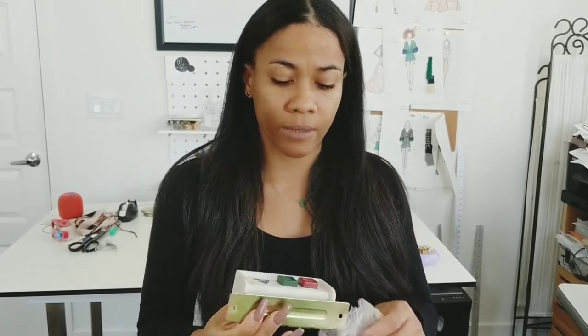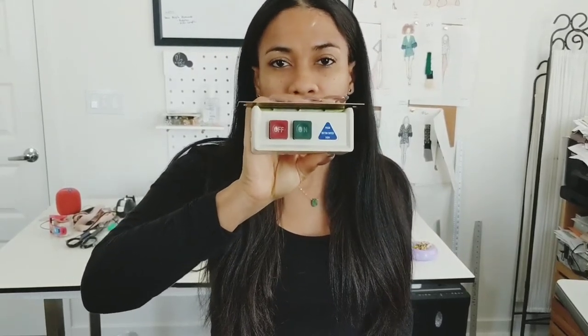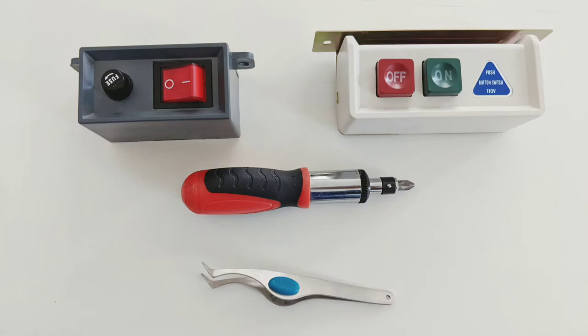Welcome to this tutorial — this is actually a trial because I'm not sure what I'm doing. Hopefully I don't get electrocuted, but the power switch on my machine went out earlier this year. My technician came out and fixed it, but it's not working again. It's the one with the little fuse, so I'm going to attempt to take that one off and replace it with the new one he sent me. First things first: unplug your machine.